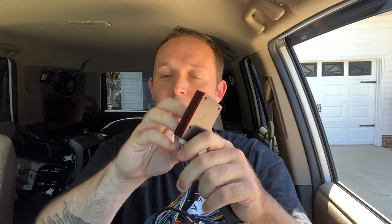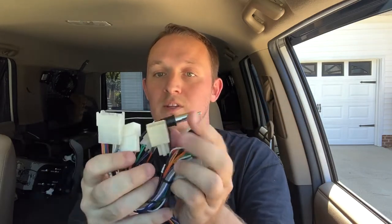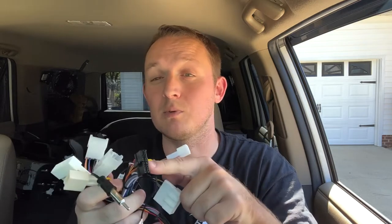This box covers all the wiring configuration and your steering wheel controls, plus all the clips for everything you disconnected on your factory radio. I think there are about two that you don't actually use, so don't be intimidated if something can't be plugged up — it's not meant to be. They use these kits in a multitude of different models and makes, so a plug used in your car may not be used in a Camry and vice versa.